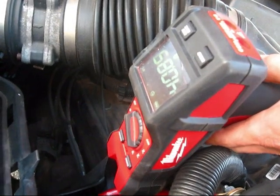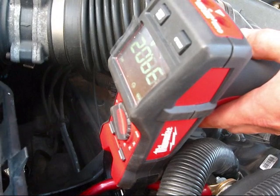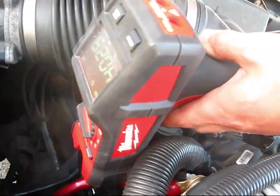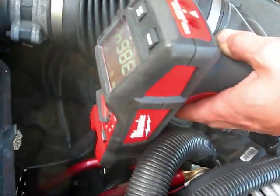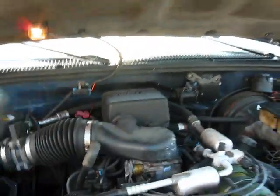We're getting up to 41 amps on one Audio Cue 3500, which is not bad. I'm pretty happy with that — still don't need another alternator yet, so that's a good sign. If we double that with both audio cues that's only gonna be 80 amps total.